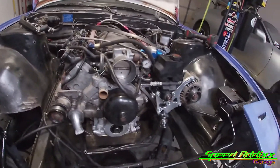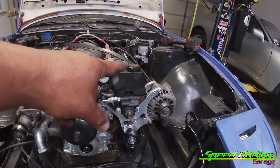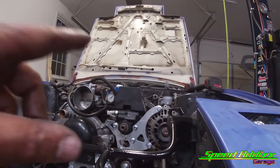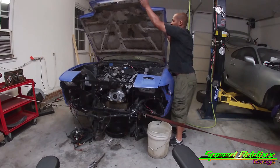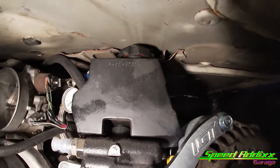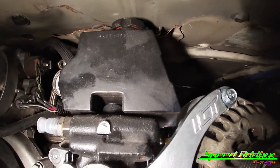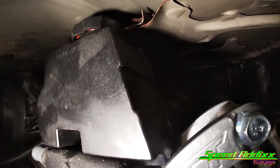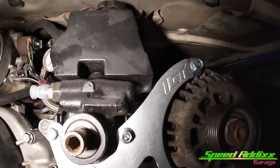The main reason I wanted to go ahead and install this kit is to make sure my power steering pump clears the hood. I've already cut the webbing out on that side — when I had my RB25 with the big BorgWarner S366 on it, I had to notch that out. It looks like I've got a little bit more to notch out, but I am happy. The hood is completely closed. And if all I've got to do is notch out just a little smidge more of that webbing on that hood, man, I am good. I consider this a success.